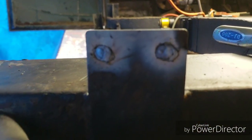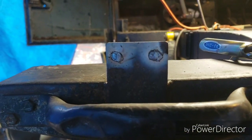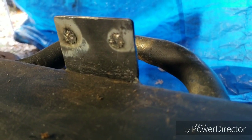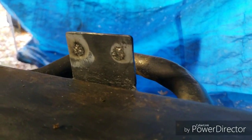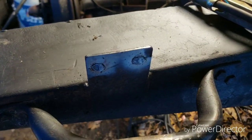Here are the results — melting plugs from welding that up. The backsides are pretty darn close to perfectly flat. That'll be good. The backside shouldn't need much dressing — a little bit of grinding on the front and they'll be good to go.